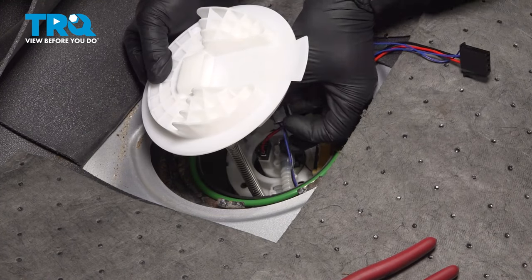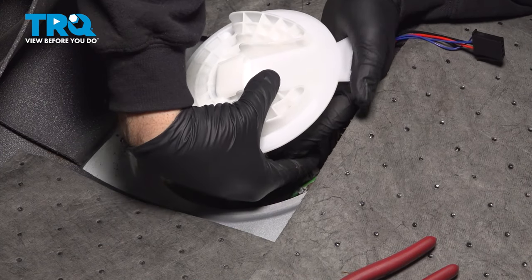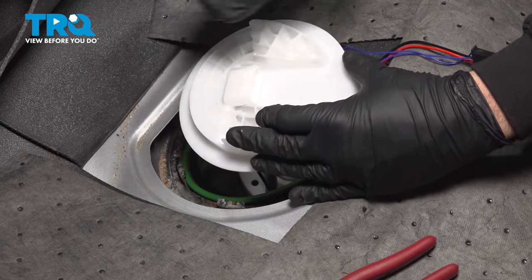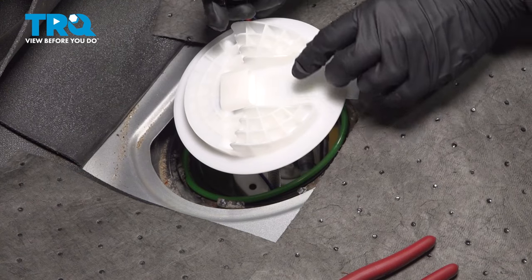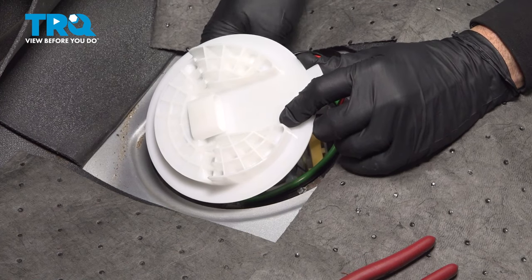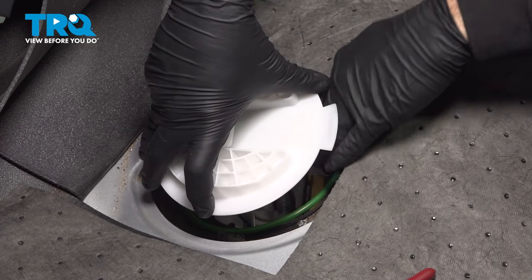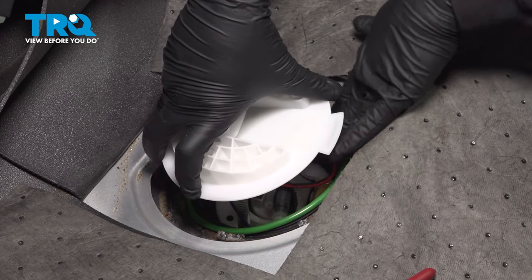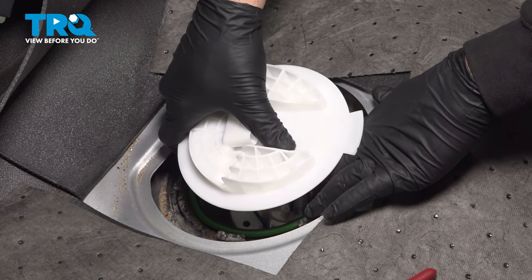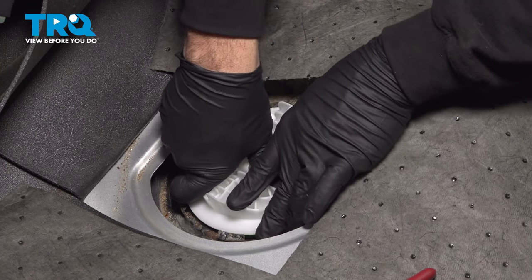We can line up our connector on the bottom here, press it up through the bottom, do the same for this here. You install these here, the clips go on the outside, same on the other connector in there. All right, both connectors are snapped on. Tuck our wires down inside. Make sure that O-ring is seated. And go ahead and lower this unit down into place.